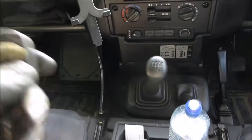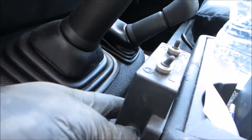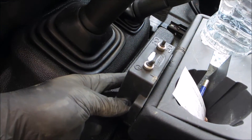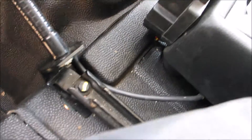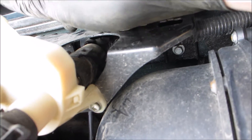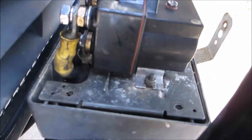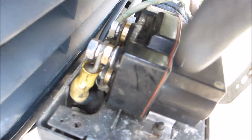I'm at the front, just finally spooling it away. I can just switch it on and control it. I'm going to mount the controller box up there — very convenient, not exactly in the way either. You can see I've run the cable routing behind the matting — it runs up the bulkhead, it runs inside. Just behind the heater where the control pipes are, there's a rubber grommet. It comes up the bulkhead, then runs straight down into the convoluted tubing, comes out along the chassis rail, and comes up here — this is to my old contactor.